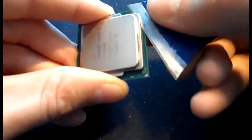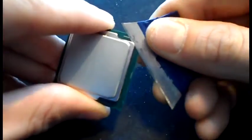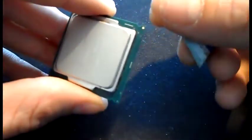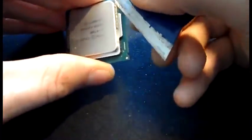That just slides in there. If you take a look at the picture below this video, you'll see there are no transistors for you to hit, so as long as you don't push this in too far you're not going to have any issues. Push the internal heat spreader towards the top of the chip - this is so important. If you cut through the PCB there's a high chance you'll break your chip. Don't use too much force either - these chips have gone from £298 to £375 in the UK, so you want to be careful.